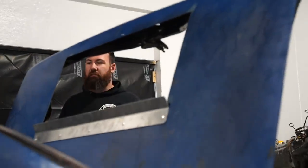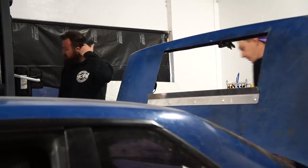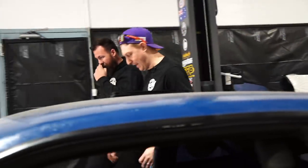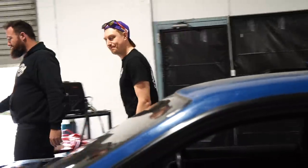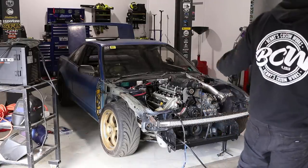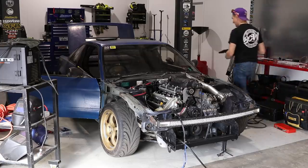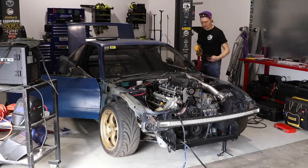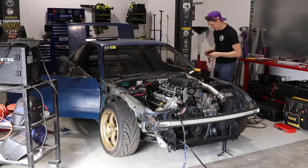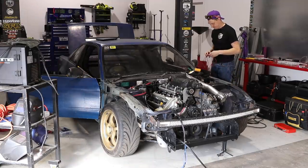Actually, what it would be easy to check, see if the output side of the relay has power at it. Oh, yeah, because then if it's a common... If my wire has power... If your triggered output, like your output to the ECU from the relay, has power on it, you know that it's getting backfed from somewhere else. Potentially there's two pins to the ECU that can be powered. Yeah, okay. So it could physically be a different pin, but it's still just powering up.